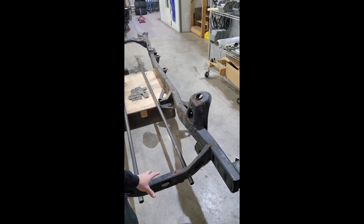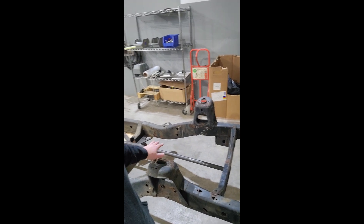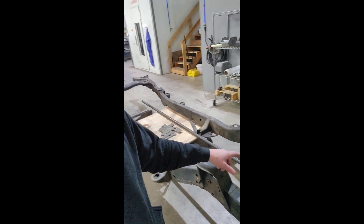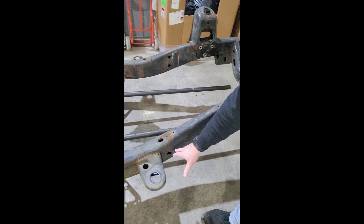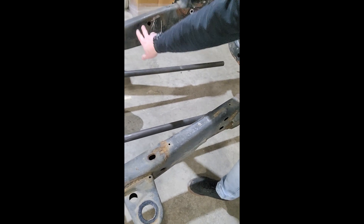I'm going to run these inter-frame rail bars all the way up. There's still debate whether I'll dogleg these bars so they kick up slightly in the front, since they don't need to be that low up front — they can ride along the same height as the frame. Right now I have it sitting on this rolling dolly. As they come up front they'll kick up a little bit and run into a tubular cross member. My A-pillar bar drops in right about here, forward to this body mount, with some wiggle room. There'll be an outrigger bar that goes through the frame rail, notched into that bar, with a connecting cross bar on each side.